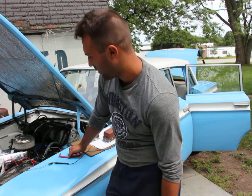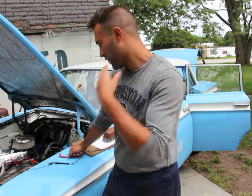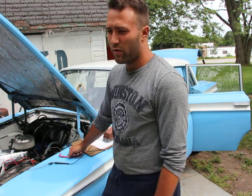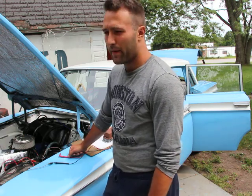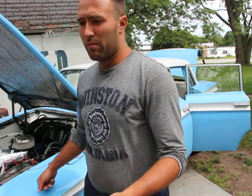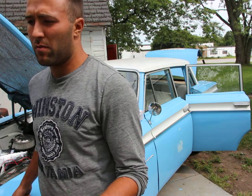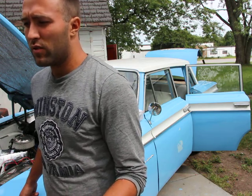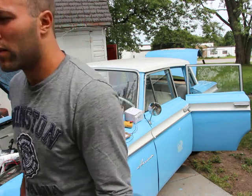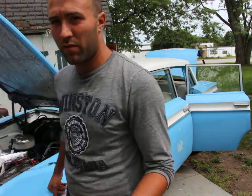other circumstances as well. So the manual actually lists a few voltage ranges. And like I said, today we're at about 65 Fahrenheit or about 20 degrees, so voltage should be at about 14.4 to 15.4 volts.